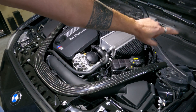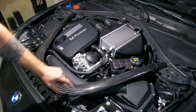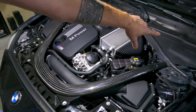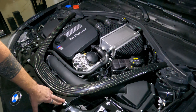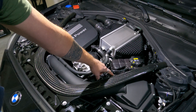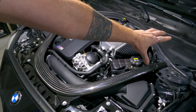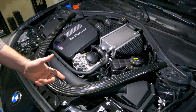Then we're going to have the 13 millimeter bolts at the top that we're going to take out - 13 millimeter on both sides and 13 millimeter at the bottom. Now I may say it more than once, but the 13 millimeters you have in the back are longer than the two in the front. So when you put it back, make sure the shorter ones go to the front. There's also a 10 millimeter here that attaches it to this reservoir. So pull the plastics off first, then remove all the 13s all the way around and the 10 millimeter, and put it safely aside.